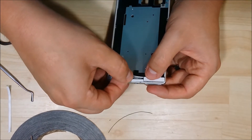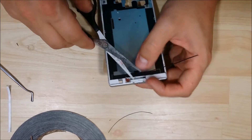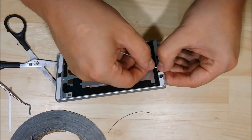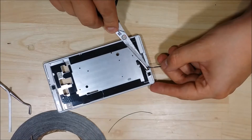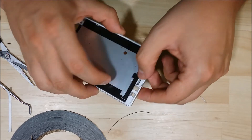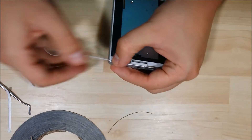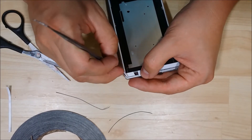I'm just going to try to cover up a little bit more of the places here, right across the bottom of the earpiece speaker into the front-facing camera — places where we didn't have a lot of adhesive on it. This will also give us a good area for our new speaker mesh we're going to be putting on. Just try to cover up all the little gaps to get a little extra adhesion in the surface of the display mounting area.